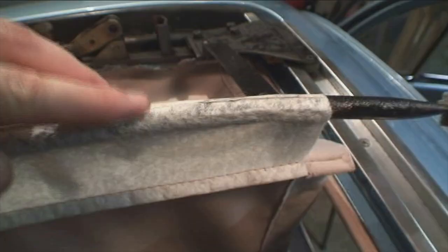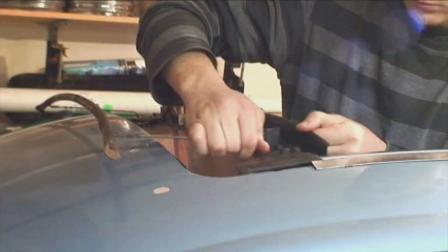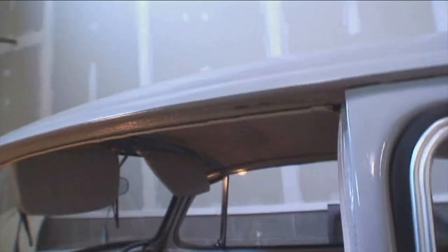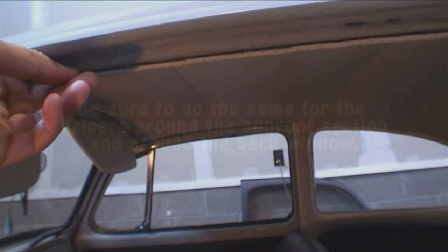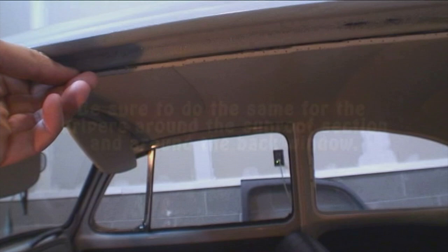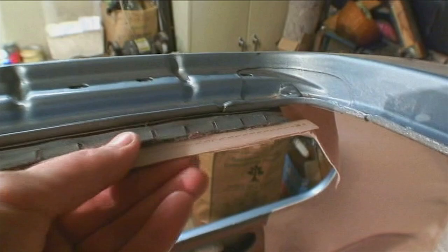Once the rag material is off the car, you're going to have to cut the headliner loose from the bows. Once that's loose, slide the mechanism back and pull it out from the top of the car. Then take out the chrome rails on either side of the roof. Next are the teeth — the grippers up here that hold the headliner in. Get in there with a screwdriver or putty blade, start opening them up, and the headliner will start to come out from the sides. Be sure to do the same for the grippers around the sunroof section and back window. Around the square section, get a pair of pliers and start prying out those grippers. Pull them out nice and flat to take the strip out all around the square section of the opening.